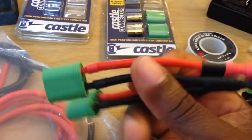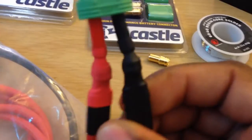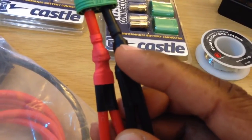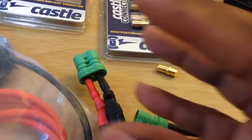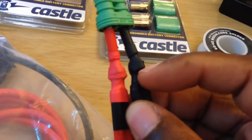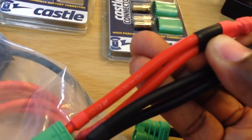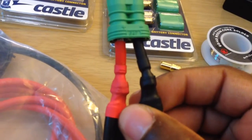Simply what I did — you already know how to do the two battery end connections. For the Y-split end, as you can see clearly through the wrap, these two wires I soldered together as tight as could possibly be. Then this wire — when you open it up like a budding flower — I opened it up, put it over that connection. Remember it's already soldered inside the original connection. I opened it up, put it over that connection, crushed it down as tight as I could get it. These are 10 gauge wires, so it's not going to look that pretty, but it is very functional.